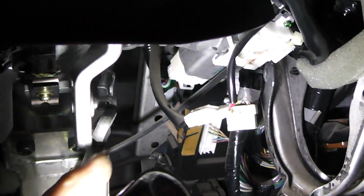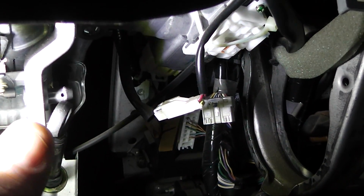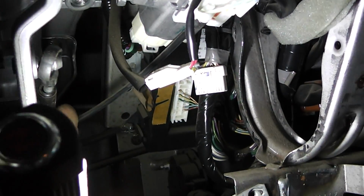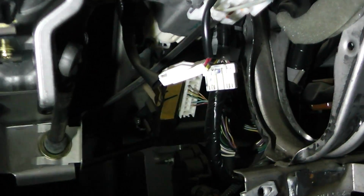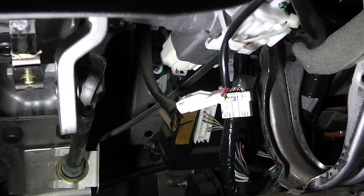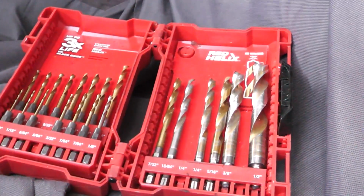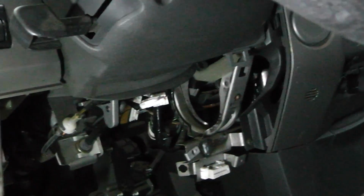So what I'm doing is I took that drill right there, and you can see right there, I've drilled a hole there. So I'm going to put a washer, I'm going to put this on, I'm going to put a washer over that and a cotter key, and that should be a long permanent repair. Hopefully it'll outlast the truck. So let's finish getting that drilled out. Got some more drill bits here, make it a little bit bigger, and get this thing fixed.